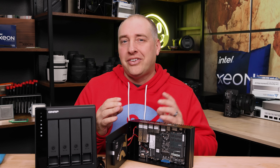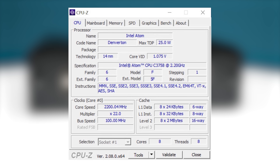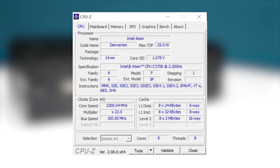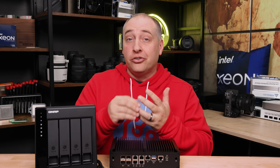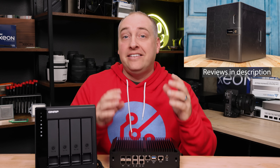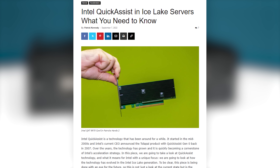Talking about the processor: it is a 14-nanometer processor from Intel, so it is an older generation. These processors are absolutely everywhere — you find them in 100-gigabit switches, firewalls like the NetGate PFSense units, and in things like TrueNAS minis. By far one of the coolest things this processor has is Intel Quick Assist acceleration — a hardware accelerator for crypto and compression. This allows you to offload those tasks so you don't need to be using your CPU cores.